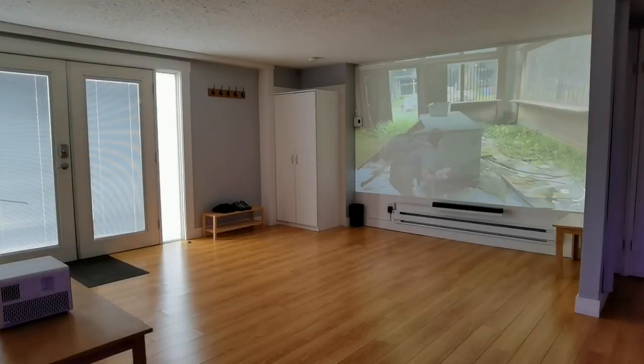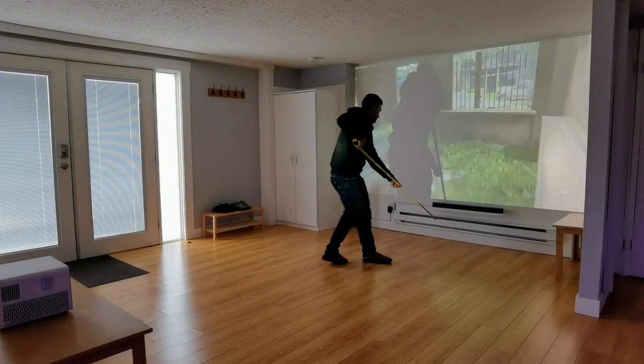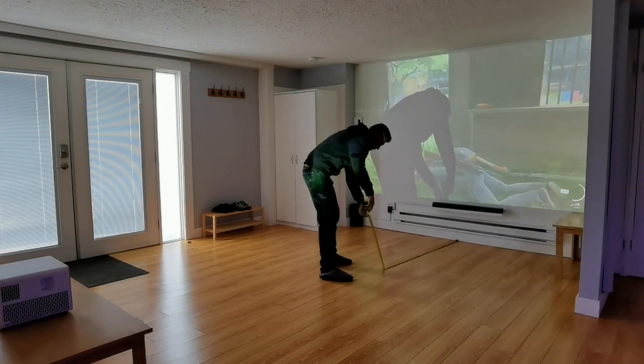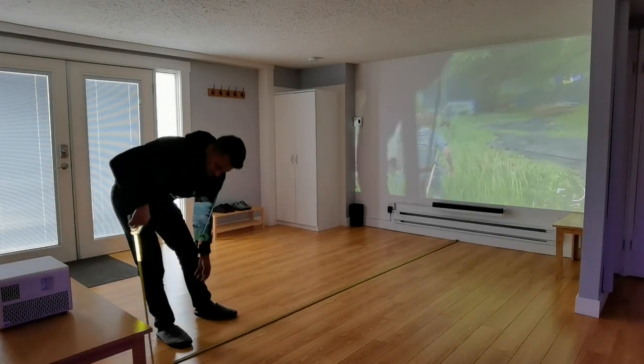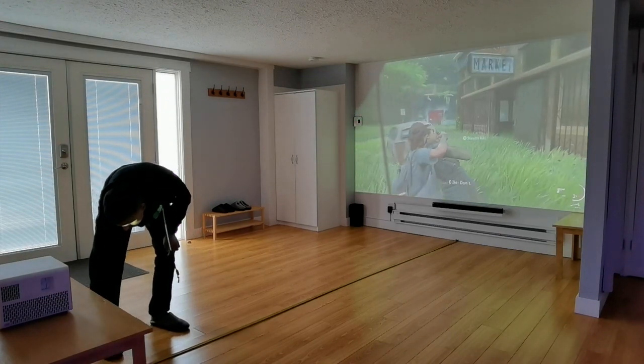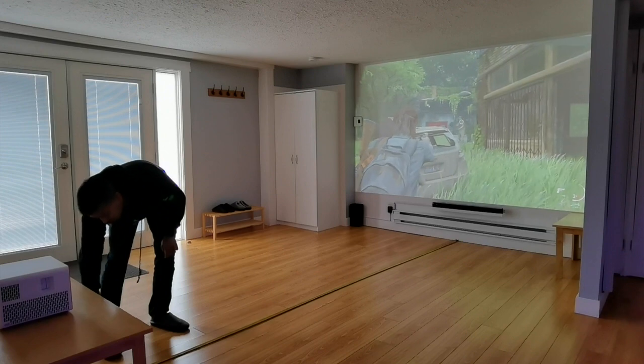The next step was to get the positioning right. I had this sitting on a coffee table, and with other projectors I would have to put something underneath to elevate it to get it to the center of the screen. With this one, I did not have to do that — I was able to just put it on and then find the proper throw distance from the wall. My wall can accommodate about a 137-inch screen, so to get that I had to have this at a throw distance of about 13 and a half feet. The screen looked fantastic. All in all, between setting up the dongle, getting the positioning right, and setting up Android TV, I was up and running in about 10 minutes. The setup of this projector is very, very simple.